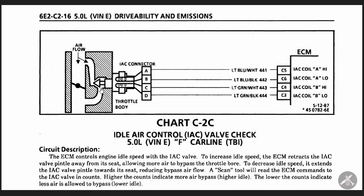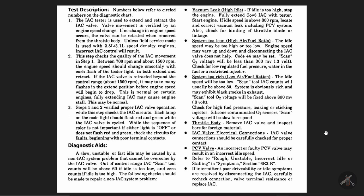There's an indication that 50 counts at hot idle in neutral is about right for this car, and I think that's about where my tuned port ought to be as well. But with the 10K mode to get data, it raises the idle speed to about 1100, so I never get counts below about 70 or 80. Probably if I was running at 600 RPM where I belonged, it would probably be sitting down at 50. This is the diagnostic chart that goes with that picture — there is an IAC tester available to manually extend or retract the IAC valve, though most of us don't have one.